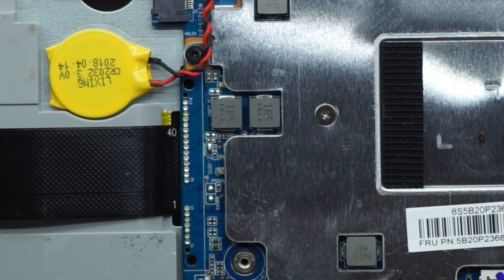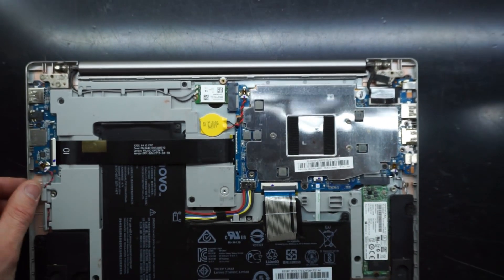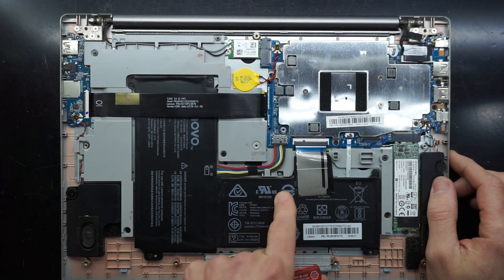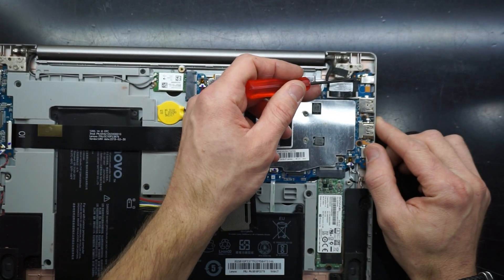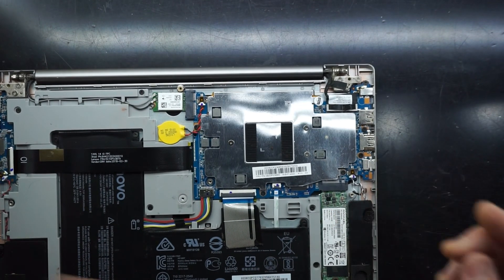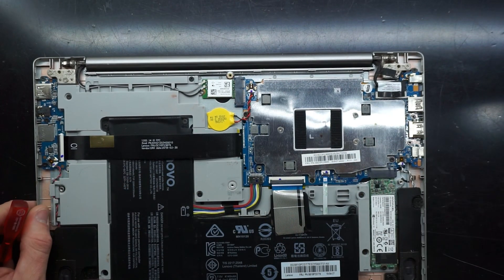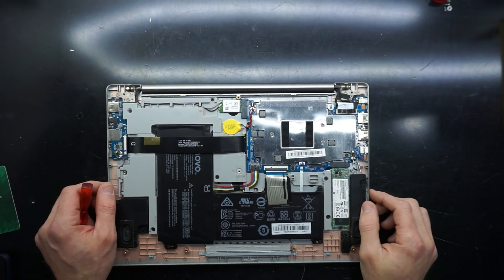I hope this helps you with your teardown or getting into your Lenovo IdeaPad. For me, I'm going to troubleshoot a few other issues — I'll disconnect the battery, connect it to power, and check for 19 volts going to the charger port pin. Hopefully that checks out and it's just the main board being confused — it just needs to lose power and restart. Anyway, that will do for today. See you guys in the next video.